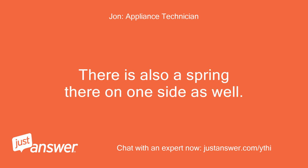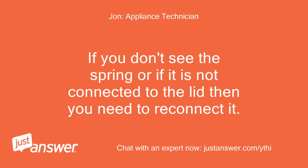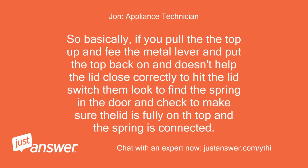There is also a spring there on one side as well. If you don't see the spring, or if it is not connected to the lid, then you need to reconnect it. So basically, if you pull the top up, free the metal lever, and put the top back on and it doesn't help the lid close correctly to hit the lid switch, then look to find the spring in the door and check to make sure the lid is fully on top and the spring is connected.